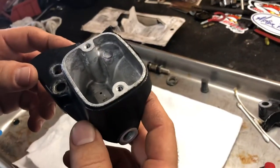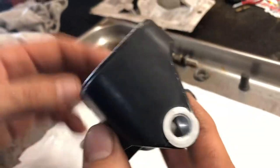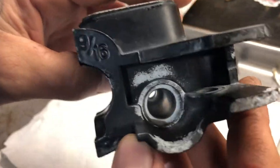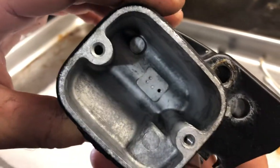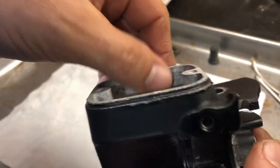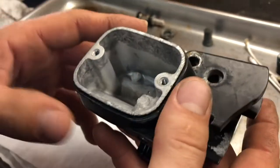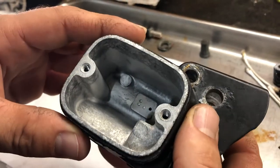All right, we got it all clean — magic! Clean the bore inside and clean the master cylinder. Now, a lot of times if the brake fluid sits too long it'll actually corrode and eat the metal, so you want to make sure you get that stuff flushed out.